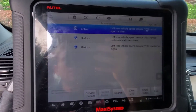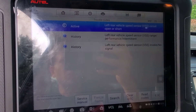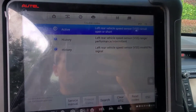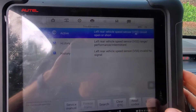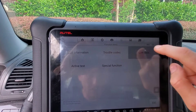The hub assembly has the speed sensor built in. Water gets in there, and there's a service bulletin. The service bulletin tells you to replace both at once. That's probably what we're going to do here. I will show you on the scan tool just what no speed signal looks like.